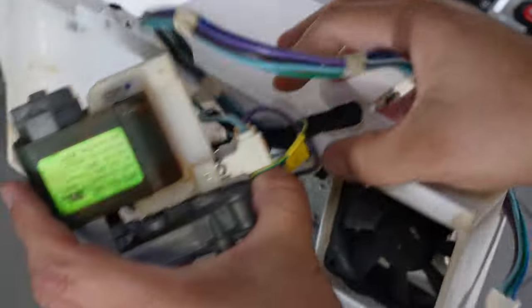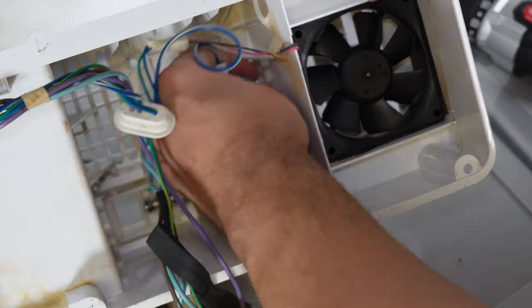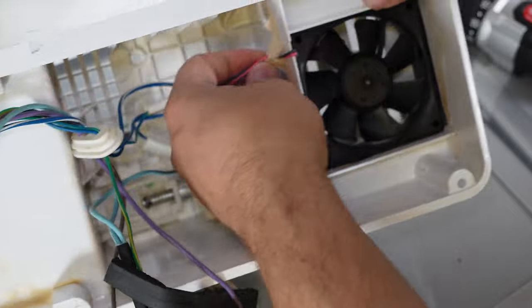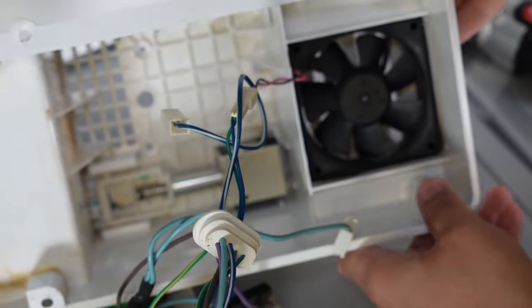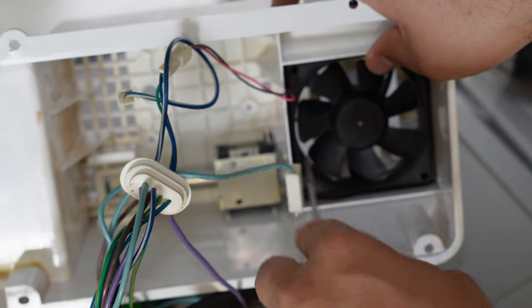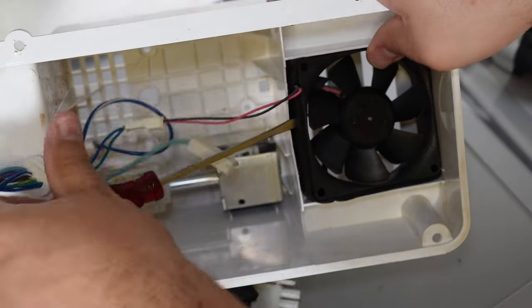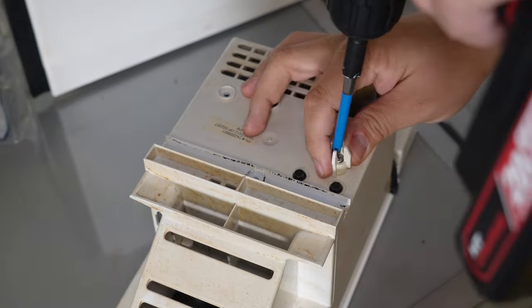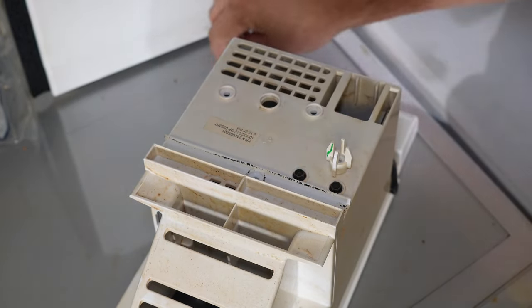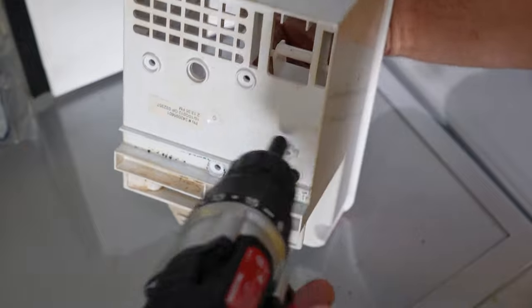From here, you can start removing wires from the air handler. There is a super small wire from the trunk to the ice maker fan, then two wires going to the auger solenoid, and then two wires going to the auger itself. You don't have to remove all of them, but it does make things easier. Next, remove the fan — be very careful as the fan blades and supports are very fragile. I slowly and gently dislodged it from the sides with a screwdriver, though a faster way would be to insert the screwdriver from the front grill and push gently on the corners of the fan.